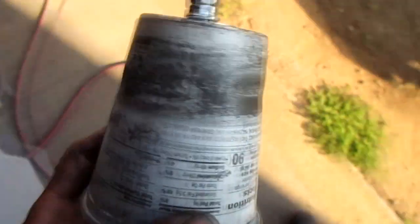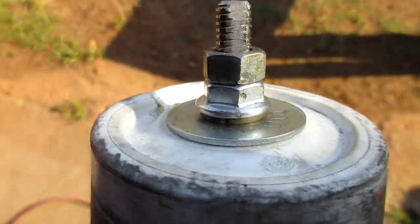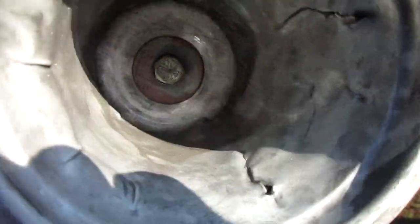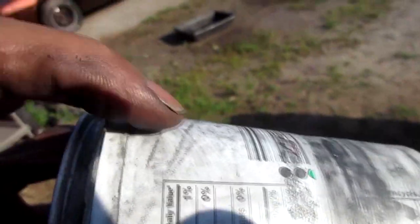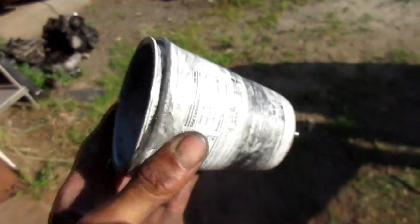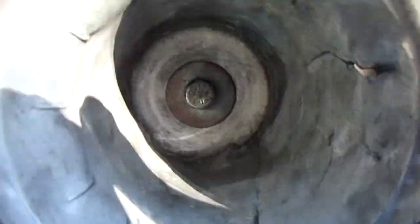So here's what I used for sanding — a couple of containers with a bolt through there, lock washer and a big fat washer there, washer on the inside. And if you notice, it got really hot, got distorted from the heat from sanding, made kind of a leveled ring, a dip in it here. I had to go get another container, so I slapped this container over the other one to give it a little more support, and I got the job done. Crazy though!